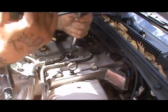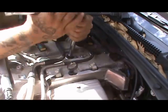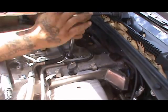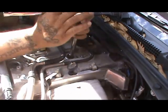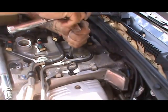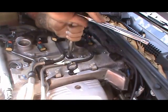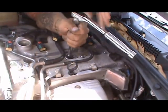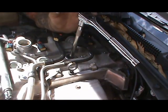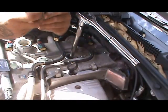I think some people use torque wrenches when installing spark plugs because of the gap or whatever. They are pre-gapped. I never used a torque wrench when doing this. I just lube and tighten it, but not super tight, if that makes sense. So again, there you go. It stopped. Twist it a little bit, leave it in. Ready for the next spark plug. Next one, fresh.